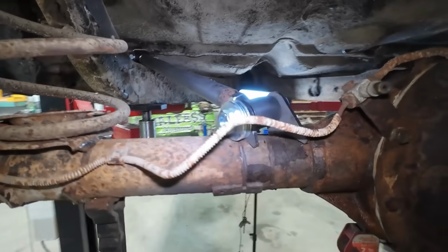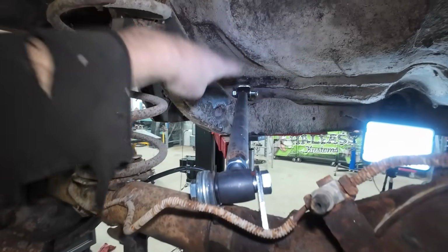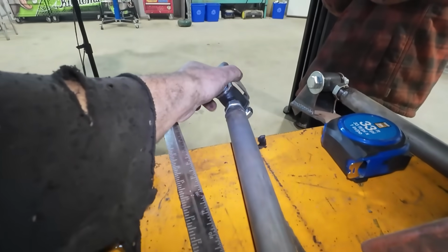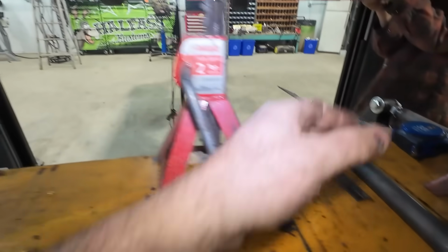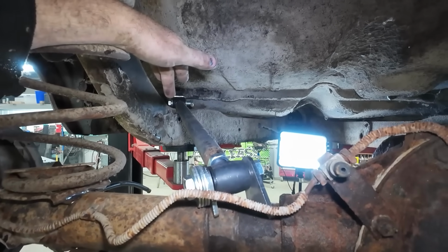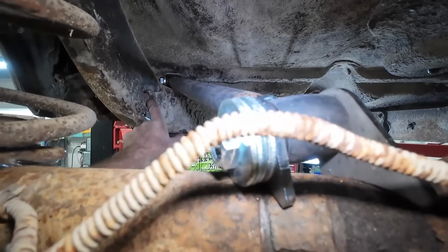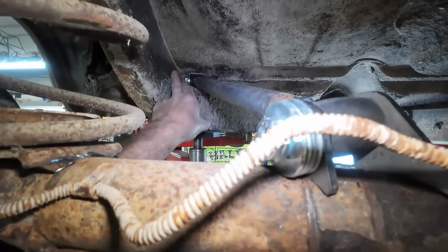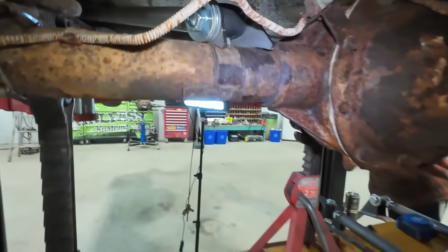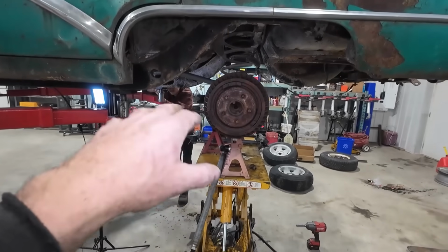The upper bar, I'm not too happy the way that one's going. Probably switch these side to side or something just so these sit a little level, but I'm pretty sure it's gonna have to go on top of the frame. The way the mount is, it's supposed to go to the edge of the frame, but we could shorten the link, but I don't really want to attach it to the structure, like this X frame, because really that tubing is not very strong. We might shorten this arm and actually attach it into this zone, but for now we'll just zap it up there. We're just gonna do a quick test fit, because it's getting near the end of Austin's time, and I want to at least get the car on the ground and see what she looks like here.